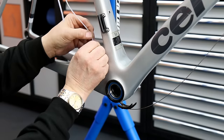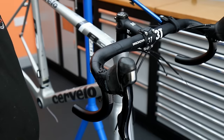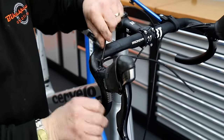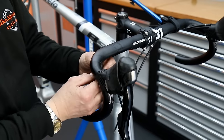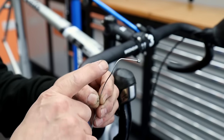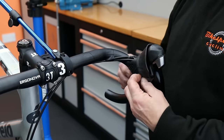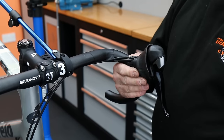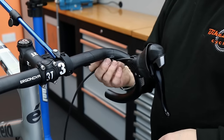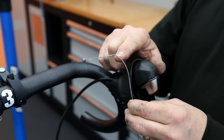We cut off the old cable and feed the outer through the frame to guide the new cable in, then remove it from the shifters. This went from just doing one cable to two, but that's the sort of thing we're trying to notice during a service so the bike goes back absolutely on point for the customer. You can see that right-angled sharp kink and crease in the cable — it would never have shifted correctly anyway. Both the rear and front cables were absolutely identical: they both had that sort of kink, having formed a shape inside the shifter.